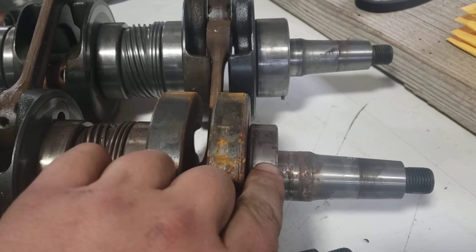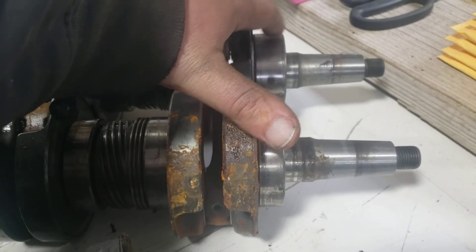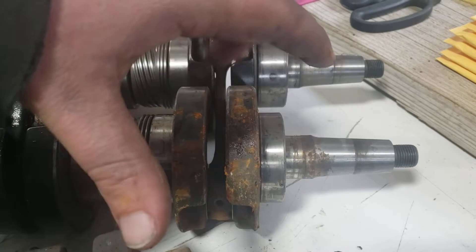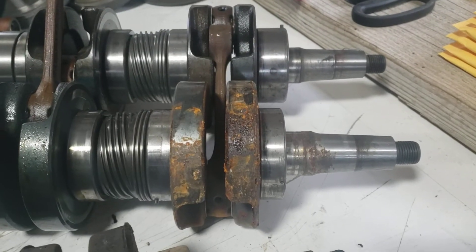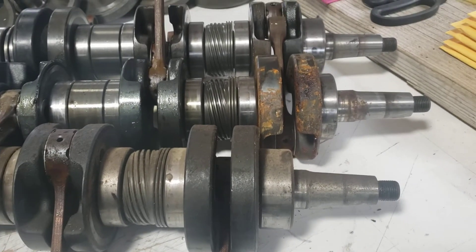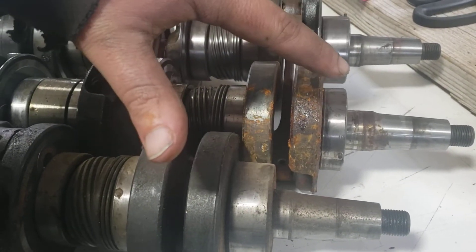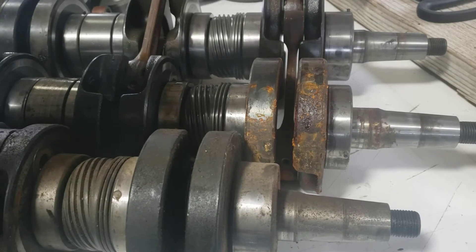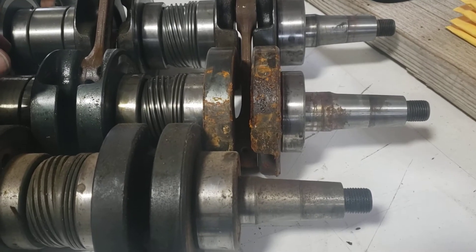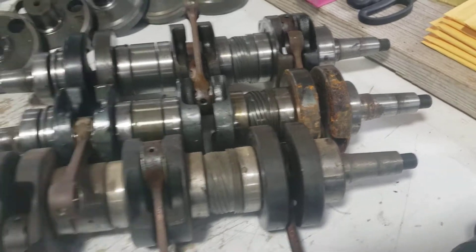The 580 and early XLT/XCR crankshafts had a narrow bearing on the mag side. This one here out of a 1996 has a wide bearing — you can see the difference side by side. If you send in a crankshaft or order one from us, please take that into consideration and look at the magneto side bearing — whether it's the wide one or the narrow one. You can send us a picture, email, or text and we can help you identify it, or just send yours in to get it rebuilt.